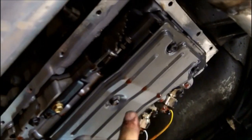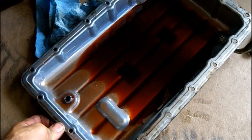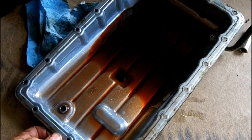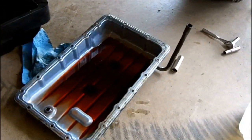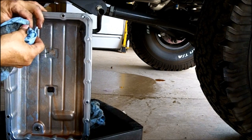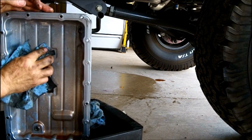This is your filter — looks like four bolts. I've got to say, that is incredibly clean. Usually you pull these and you'll get like a black film on the bottom of the pan. That tells me I could have just done a flush and not even bothered with a new screen, because that looks great. And then there are a couple of magnets in here too — these barely got anything on them whatsoever. The transmission's doing a good job. Nothing unusual in here.